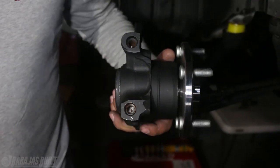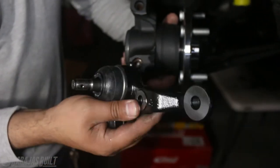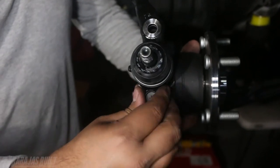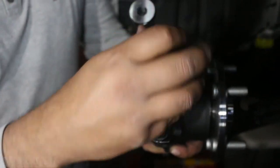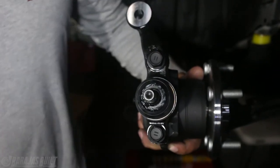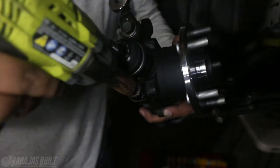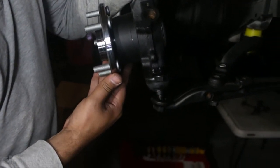One of the things we need to do is put on the lower ball joints, which are these here. We got some brand new OEM lower ball joints because these are already pressed in to a brand new piece of metal, so we don't have to worry about that. It's cheaper and easier going this route instead of having to try to press in a ball joint. And you can't go wrong with OEM — this is the one you really don't want to fail, because if this thing fails, your car is getting damaged pretty badly.